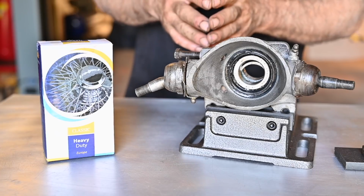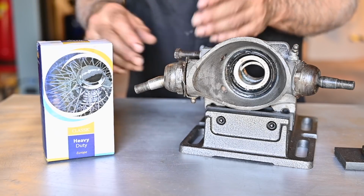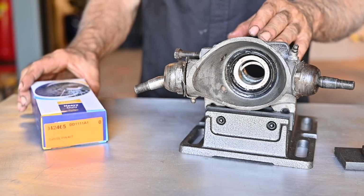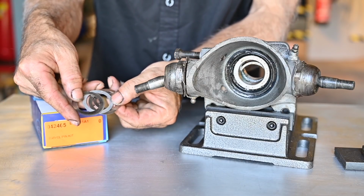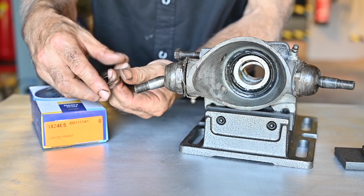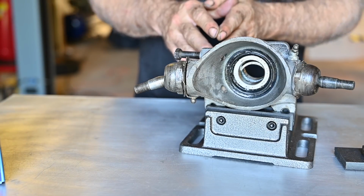So what we're going to do now is look at a ball joint, how it's been fitted together. We'll disassemble it and then we'll install a new one. There are some very specific things you need to consider when you install a ball joint, because you will have to check the play of that. For that play you have adjustment: a whole bunch of little spacers or washers of different thickness. There are different methods of doing this. I have my method, some people use another method, but that's all right. We'll see how we do it.